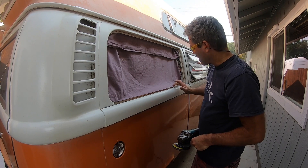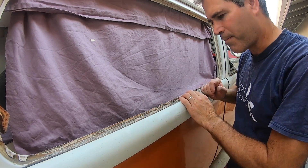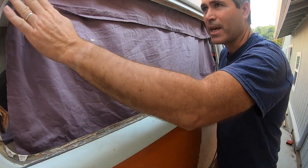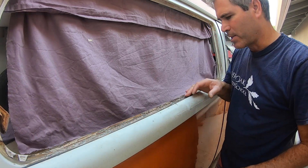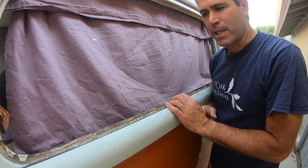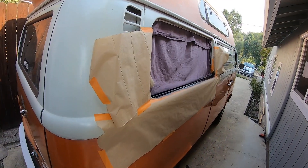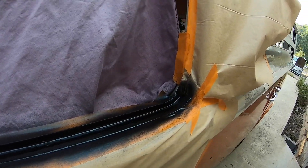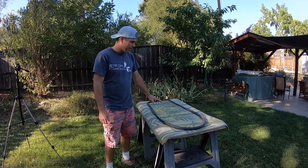As you can see it's really doing a good job of taking a lot of that surface rust off. I've got the rust on the channel pretty well cleaned up. The last thing I want to do before I put a little bit of paint on here is take some soapy water and really clean this channel up — there's some dirt in there and I want to make sure it's really nice and clean before I paint it and before I put the new window seal in. I've got this channel nicely cleaned up and put a couple coats of Rust-Oleum on there just to keep that rust from coming back, so now it's ready.